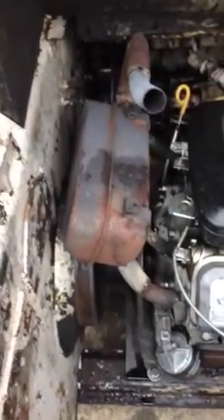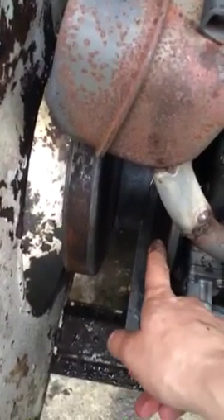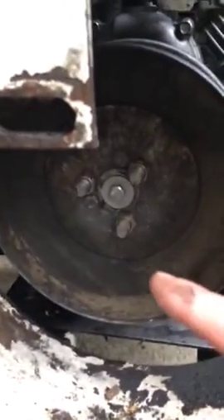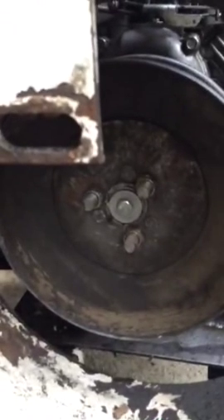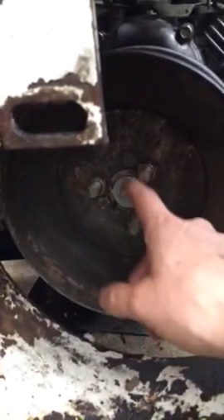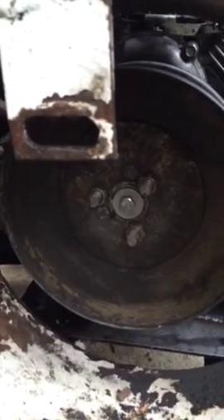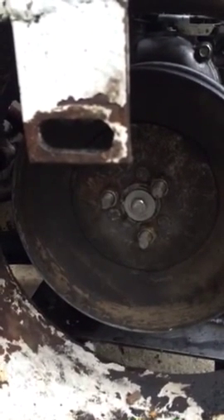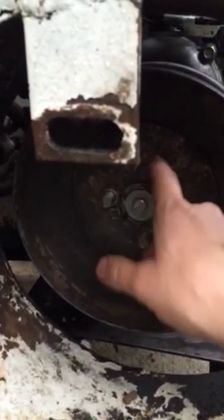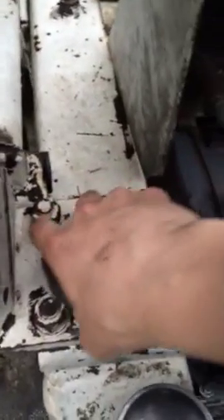I welded the bolts onto the sheave half that's closer to the engine, so the whole thing just separates. To separate it when needed, I apply my big fat tie-down, yank the belt back, grab a big fat 2x4, loosen the bolts with an impact, and then whack the bolts with the 2x4 — the whole thing will separate. Hit them with wood, not a hammer, because you'll damage the bolts and the last thing you want is the threads getting screwed up. Then you can pull it apart and either add or take away discs, whatever you need to get your speed right.